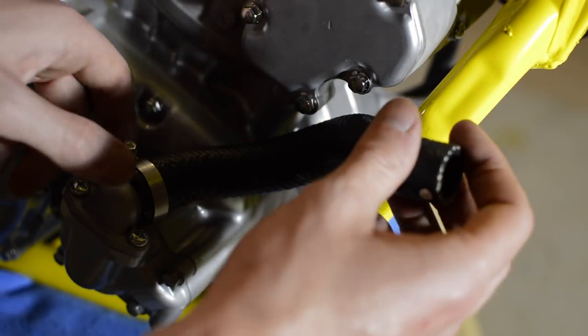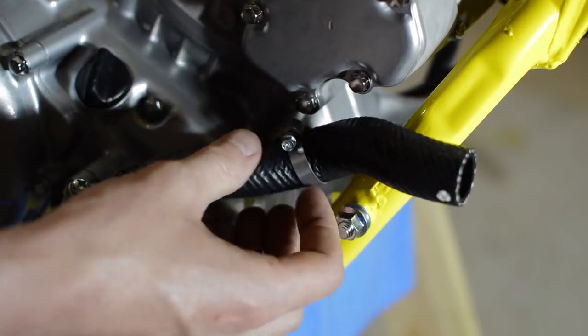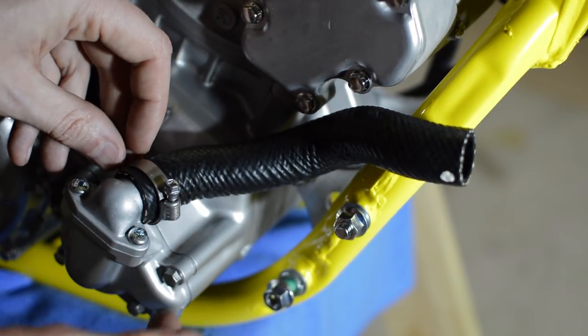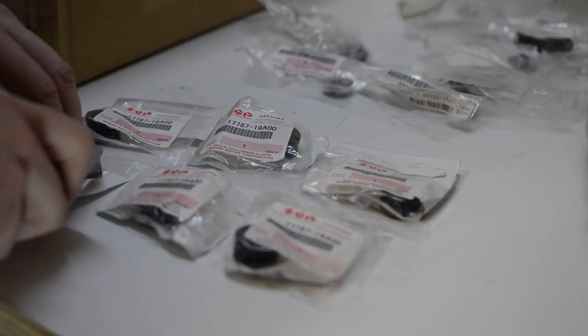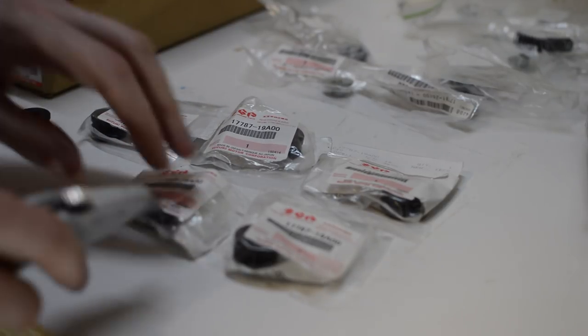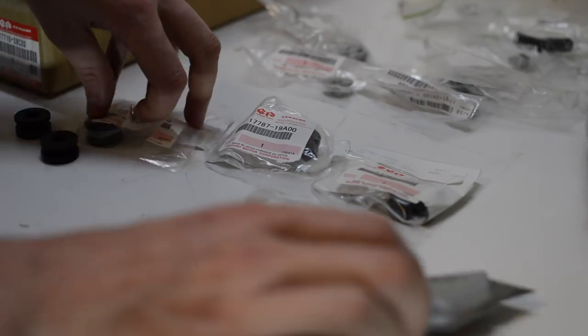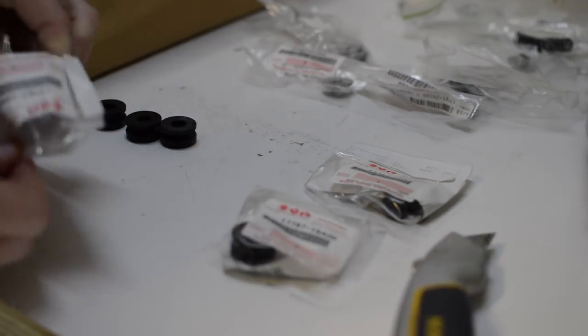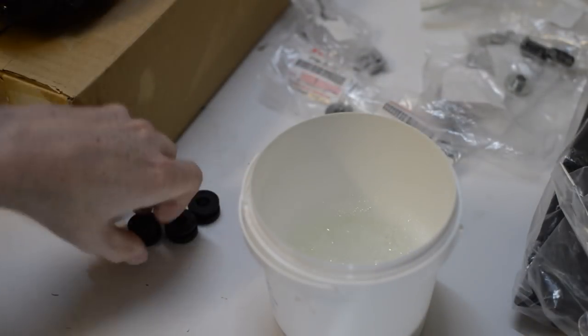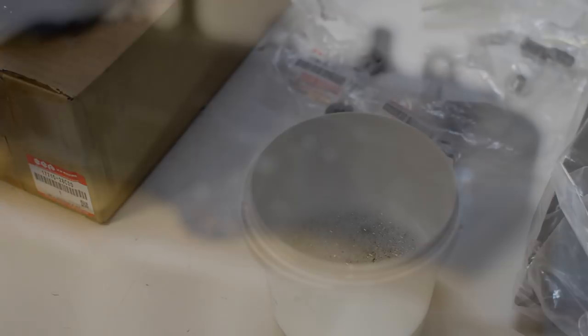After installing the first clamp, I noticed in the workshop manual that I'd had it the wrong way. And with my OCD running overtime, I thought I'd better fix it. Before installing new rubber mounts, a dip in some soapy water helps with fitting to the radiators.